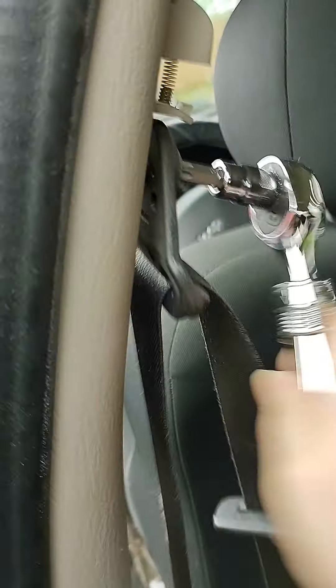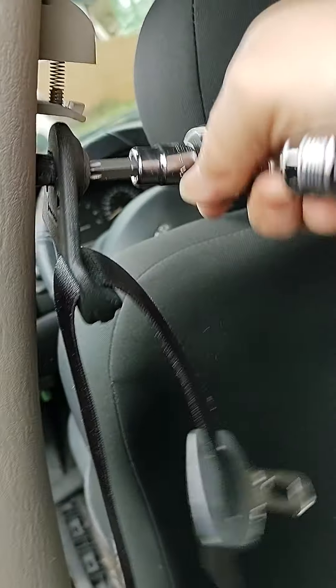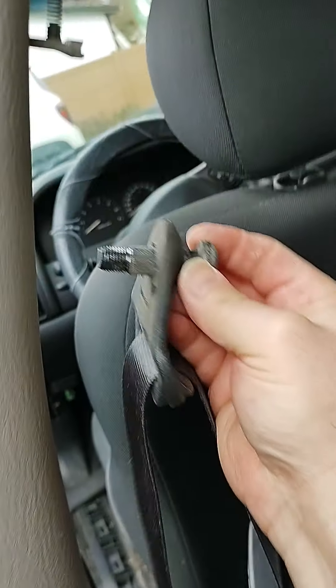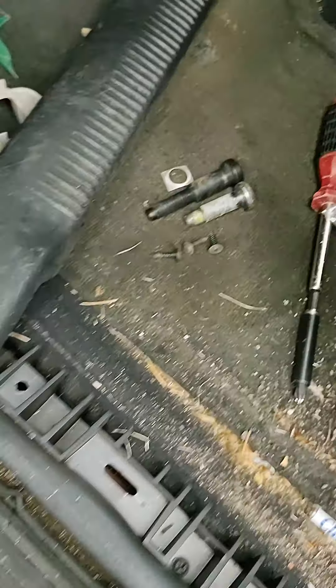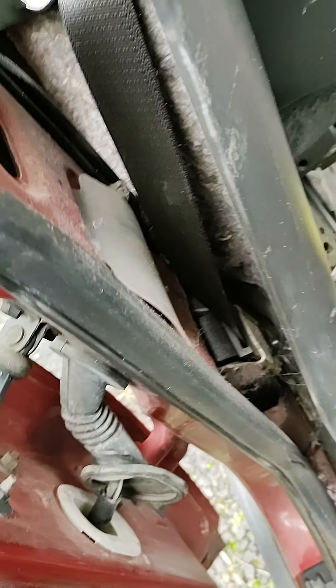The shorter one's up here. You pull it off and it's a shorter bolt on top. You then pry the rest of this plastic piece off. After that you've got to have gloves because of the mold on the seat belt - it's on there and kind of hidden but it's there.